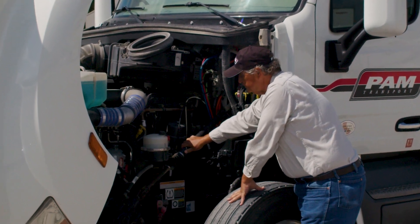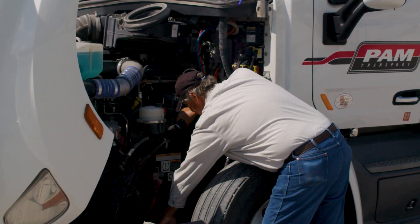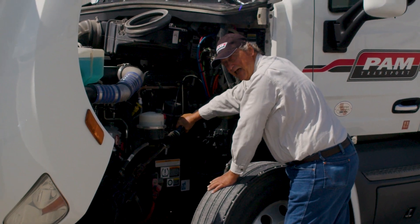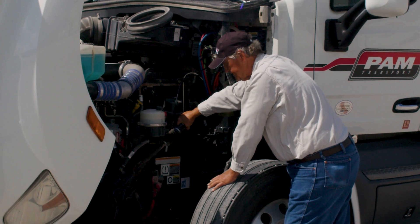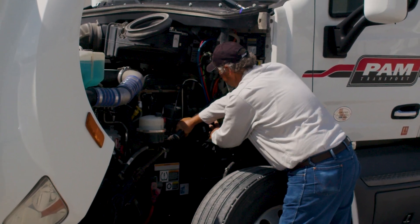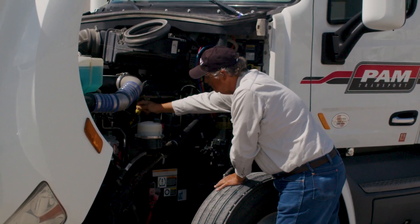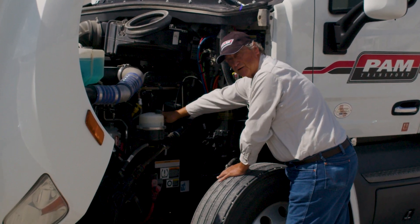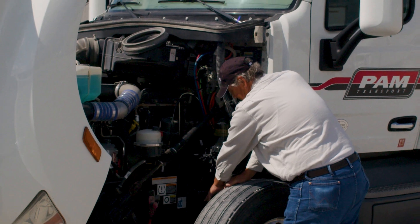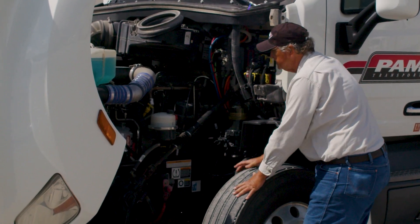Then you'll come down to your steering system — your steering gear box, your Pitman arm, your drag link, your steering knuckles. They should be secured with castle nuts, and the castle nuts should be secured with cotter pins. Check the play in your steering column — make sure there's no excessive play. It's clear of any debris or obstructions and properly lubricated. Check your oil — pull the dipstick, check the oil level. Check the spring hangers here, the U-bolts and nuts, that they're properly secured. Again, the shock absorber, the leaf spring — make sure everything is safe and intact.